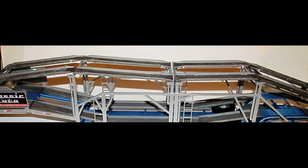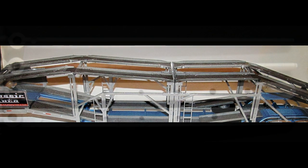Now there is 1 cross member to add in the frame for the C set of ramps, and on the D set of ramps add the hydraulic lock shafts. Now install the ramps in order A, B, C, and D from the front to back on the top frame. The cross members will have pins that will slide into place.